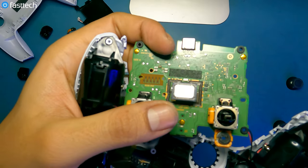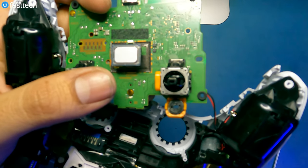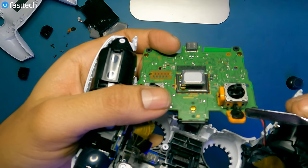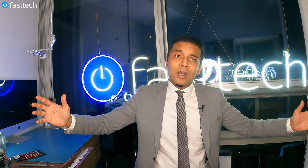I'm just going to spray my alcohol in there and run my Q-tip inside in a circular motion. It still amazes me that they would choose this old analog stick design when there are hall-based sensors out there that would prevent this problem from happening. But anyways — we're going in a circular motion here, cleaning as much as we possibly can. You want to do this with all four of the analog stick position sensors — there are two for each side, for the X and Y axis. Repeat this process a few times until you're satisfied with the clean.